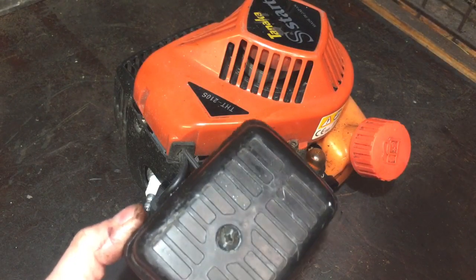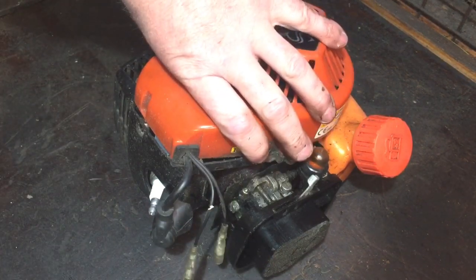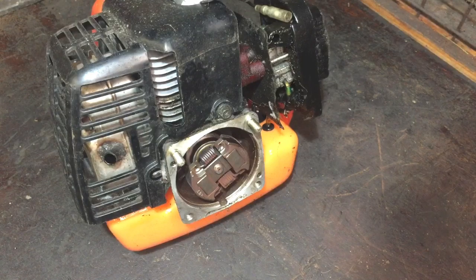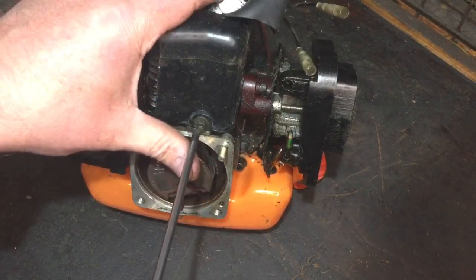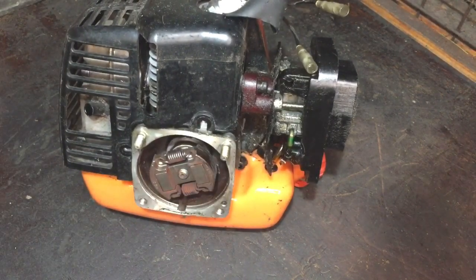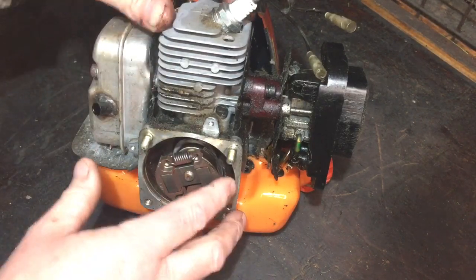I've taken the air filter cover off with that one screw to get the throttle cable out, and two wires came off. There are the bolts from underneath — two of them are just normal nuts and two are Allen key bolts. That was all easy enough. Now I can easily get to the exhaust. I'll just unscrew that last screw holding the exhaust cover on. I might have to take the spark plug out as well — I'd have to take it out anyway. I'll put that cover to the side and do the exhaust now.